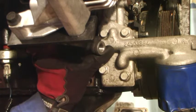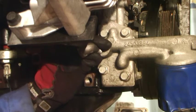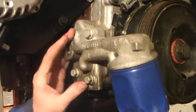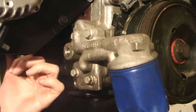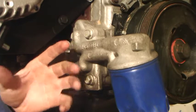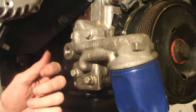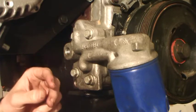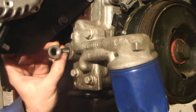When we put the elbow on, we have the option to have our oil pressure sending unit facing forward or facing the rear — it's optional. In my case it's a 50-50 decision, but I'm going to go ahead and face it this way. I'm thinking that if I ever have to service it, it would be easier to pop the fender well off as opposed to trying to get down under the car and get it.